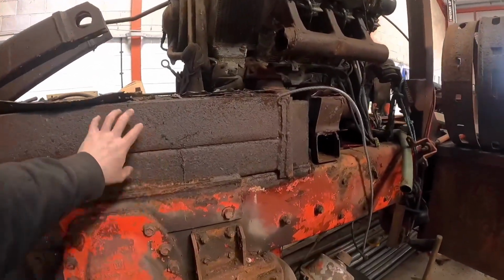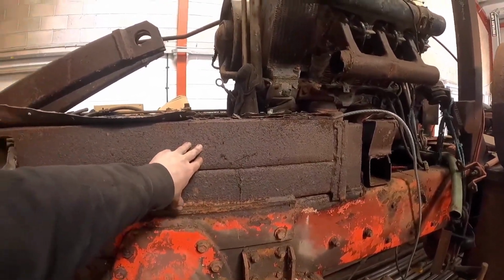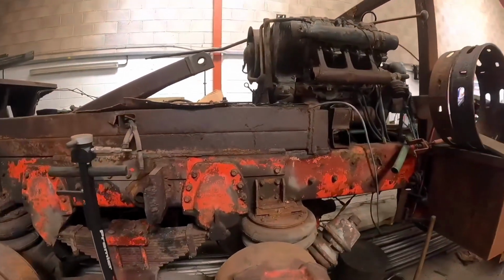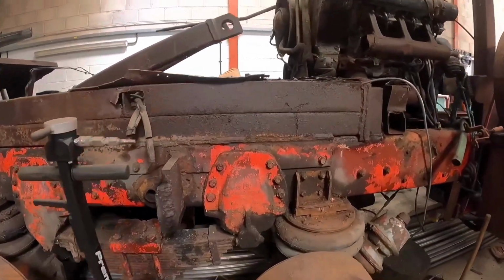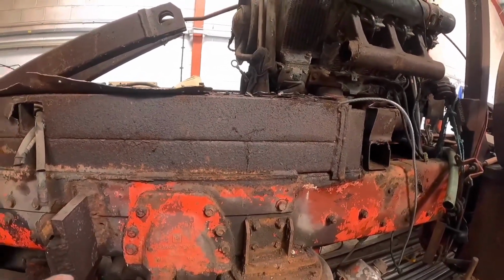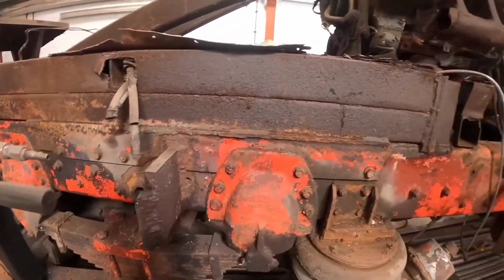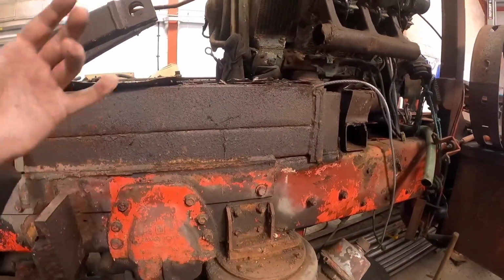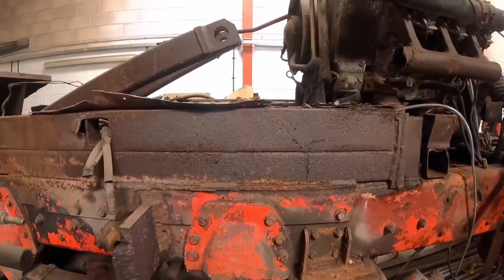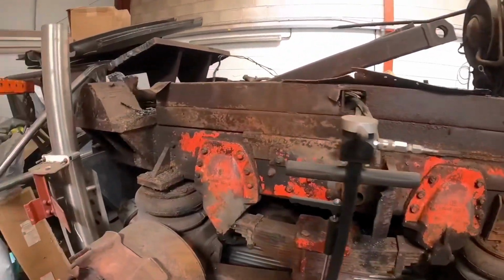So I'll cross that bridge when I come to it, but I think what I'm going to do is take some of my sleeper girder that used to be part of the side structure for the concrete crusher, and turn two cuts of it into some massive fifth wheel plates, because this fifth wheel plate here is ruined. Mount the fenders to the fifth wheel plate, the fifth wheel plate to the girders, and then everything is at the right height that way. And with some of the leftover girder, I'll make the fifth wheel ramps.